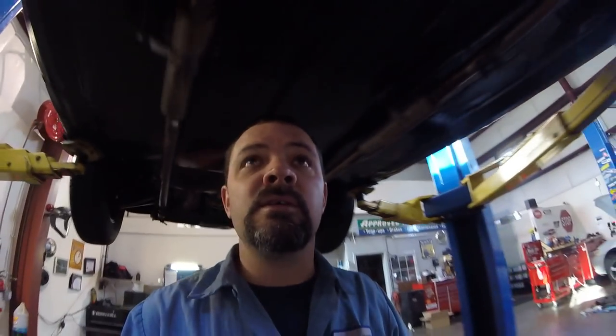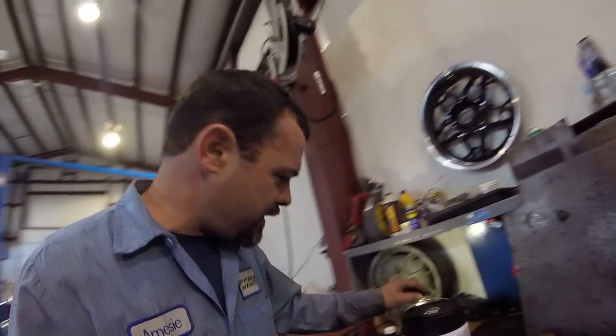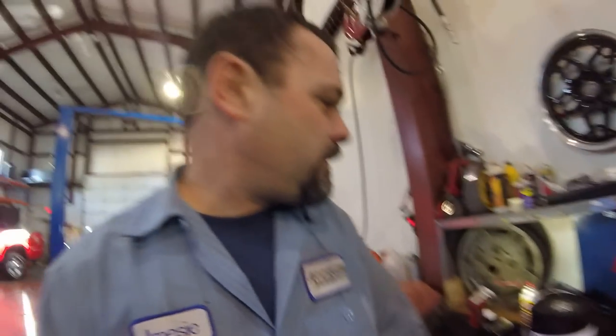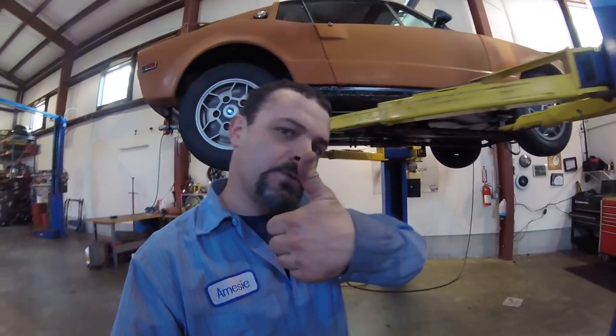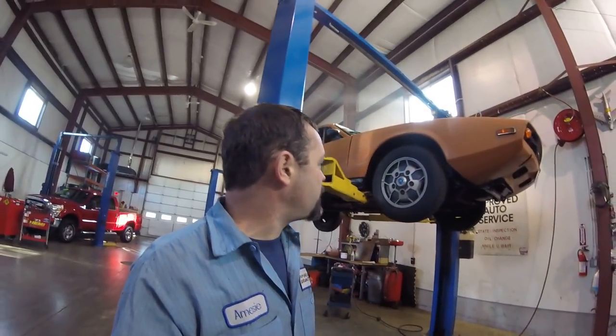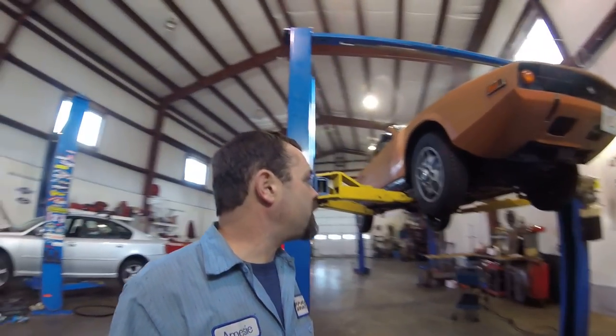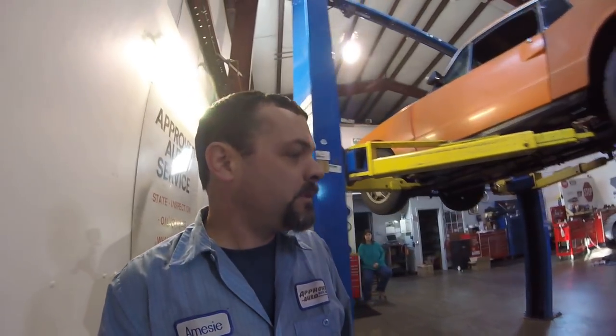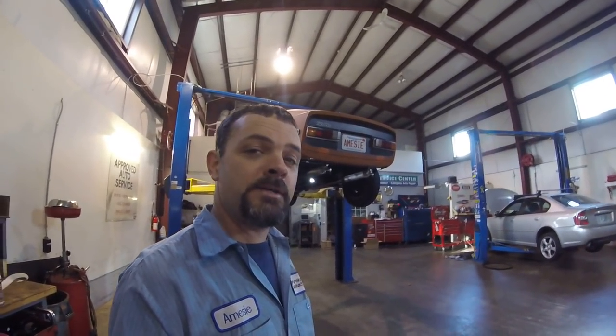You can also see just how important it is to treat it first — look how clean that Rust Mort, that phosphoric acid, got that rusty sheet of steel compared to the untreated side, and all I did was wipe it a few times. A couple of really good products here. I've got a few areas inside the rockers to treat with fluid film, and an area I want to treat with just some regular spray oil WD-40 to see how that handles it. All in all, a really nice applying product, this New Hampshire oil undercoating, and you guys all know I'm a big fan of the phosphoric acid because of what it does. If you guys have any questions or comments, leave them down in the comments section — thumbs up are much appreciated. If you know anybody that wants any of this kind of product applied, I'm going to try to offer this here in the shop. Anyways, I want to get out and do a little motoring — going to do a little drive in the Sonnet and get this undercoating to set. Until next time guys, keep it out of the cabbage.